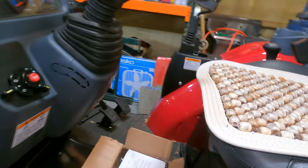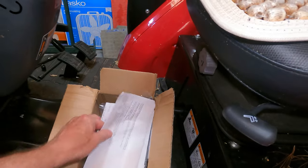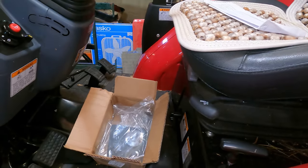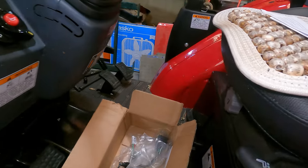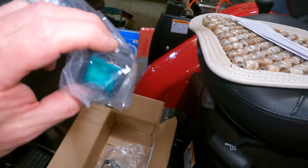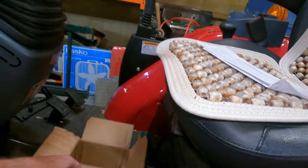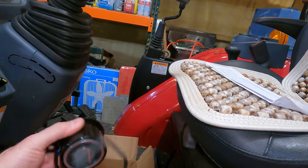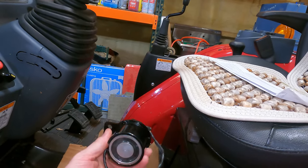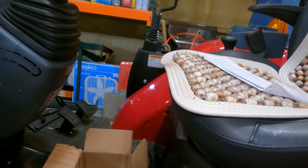What I've got here is the cruise control kit from Mahindra. It comes with a packing slip and invoice — that's it, there are no instructions, but you really don't need them. We get a new plastic surround with a cutout for the cruise control, a switch, two bolts, and the cruise controller itself. It's ridiculously simple — the holes are there, they give you the bolts, and it's just an electromagnet. When you activate it, it holds that pedal in whatever position you've put it in.